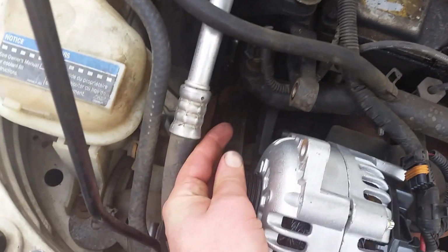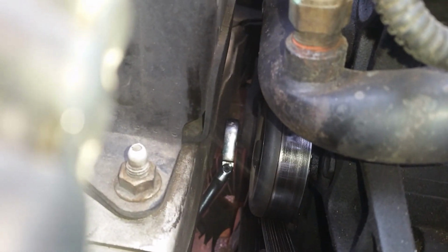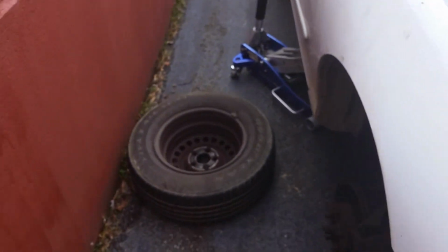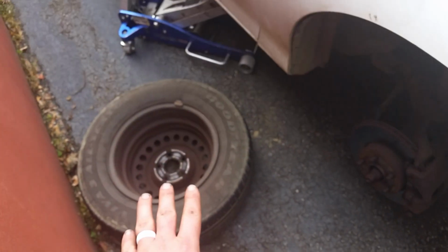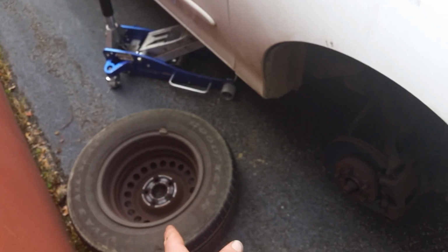of here like so. And to get this belt off, if you can see right down in there, that is my 3/8 ratchet attached to the belt tensioner. And to get a better angle on this thing, what you really want to do is take your wheel off. We got hubcap and 19mm lug nuts holding that guy on, and then we're gonna get to this thing.